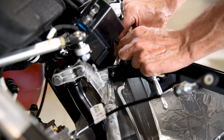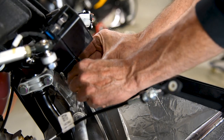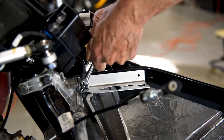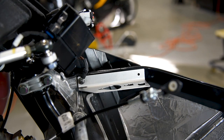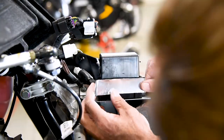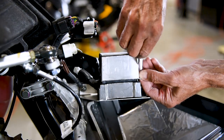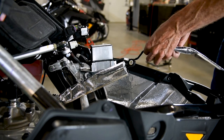Remove the bolt on the back of the front bumper on the PTO side where the brown wires are attached. Install the provided SLP fuse box relocation bracket onto the rear end side of the front bumper using the OEM bumper bolt and nut in the rear of the SLP fuse bracket. Then use the provided self-tapping bolt in the front hole of the mounting bracket. Make sure the bracket is flush with the bottom edge of the bumper and the exhaust servo control wire is forward. Heat tape the fuse box side closest to the pipe. Slip one provided heat sleeve over the exhaust valve control wire and the other provided heat sleeve over the exhaust valve servo cable.